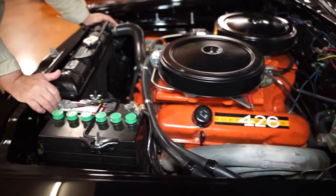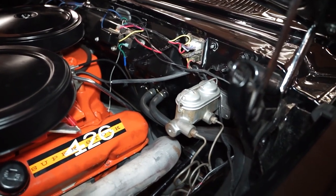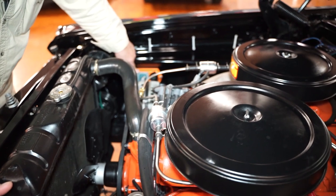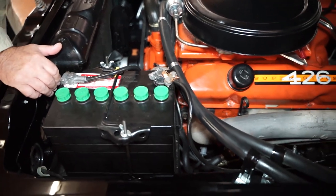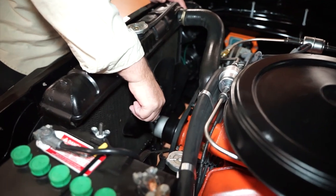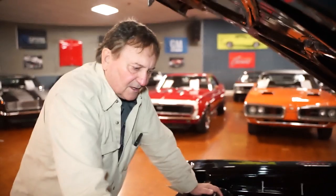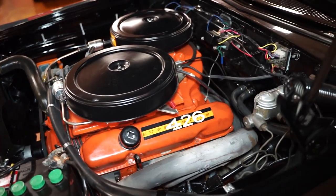The car is very well set up. It has power steering and a dual-stage master cylinder instead of the single stage, which gives you a lot of safety margin. It has a new alternator and has been upgraded to a transistorized ignition system as opposed to the standard point system. It has the correct style Mopar radiator and fan for 1963. The battery is in the front, the way it would have been on a street car had you ordered a Max Wedge convertible from the factory in 1963.